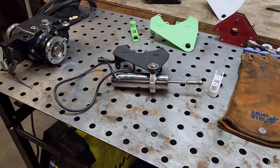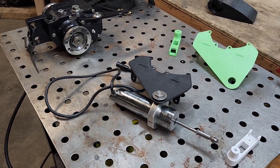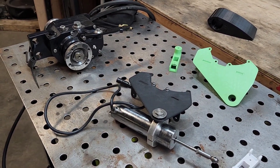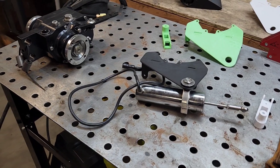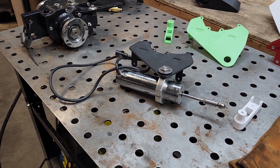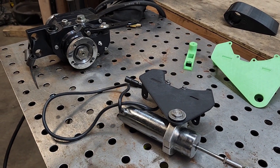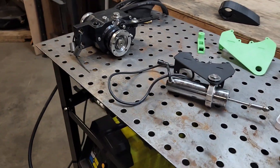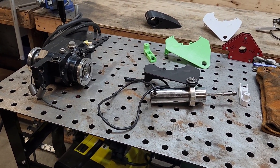Shifting will be an option. You can opt either for a manual lever push-pull type shifter — it still will utilize the sequential aspect of the transmission. You'll just need to use the clutch for everything, unless you're experienced with motorcycles and know how to do clutchless shifting. But what I think is really slick is this electronic solenoid that will be coupled with a kill module, which would allow anyone to do clutchless upshifts. They're actually pretty smooth too. You have an ability to tune the timing on the kill module to get it paired to your bike's characteristics to make that as smooth as possible.